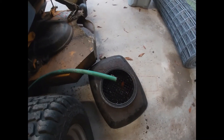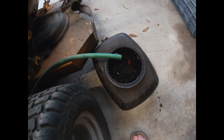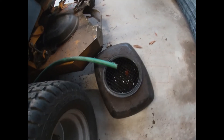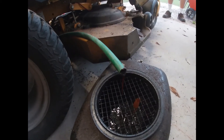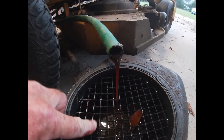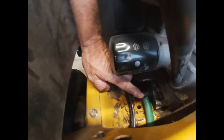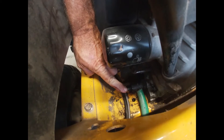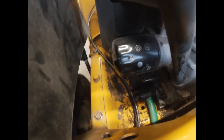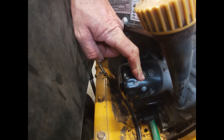So we're going to go ahead and loosen this up so we have some air coming in, and I've already got this nut broke loose. Loosen that up and in just a minute we should have some oil start coming out. There it goes — there's our oil draining. I start the engine just to warm it up; it flows a lot better. That's the spout for the hose right over here — it's plastic. You loosen it and that releases a flow of oil out of the engine block. We'll let this drain down, then take this filter off, replace the filter, fill it back up with oil, and clean out the air filter.